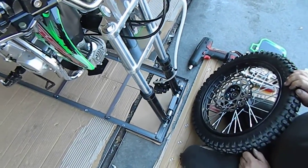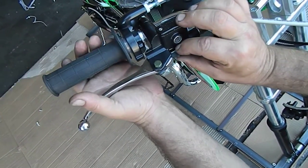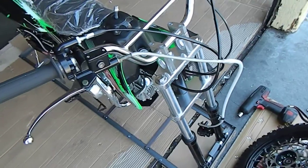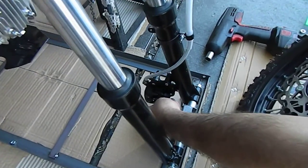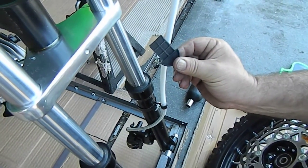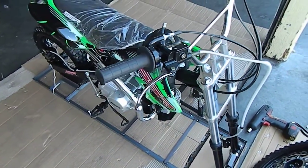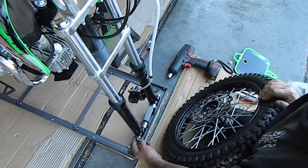Here are two other crucial elements. We have a little keeper on the front brake — you have to remove that. Ditch it, get rid of it. You'll never be able to get that front rotor through the caliper if you have that keeper on there. And here's the second keeper — just remove that from the caliper as well, that's got to go. Key point: do not depress the brake handle at this time. You don't want to pump up that caliper — we need to be able to separate those brake pads out of the caliper.